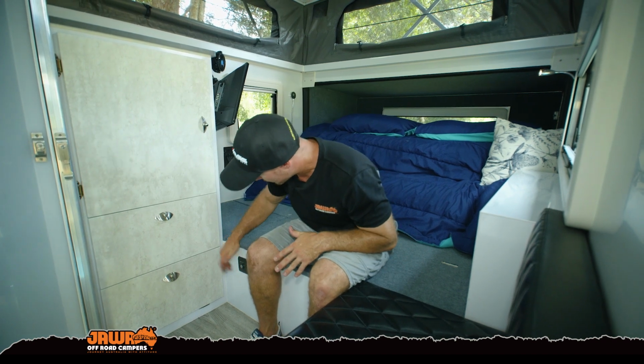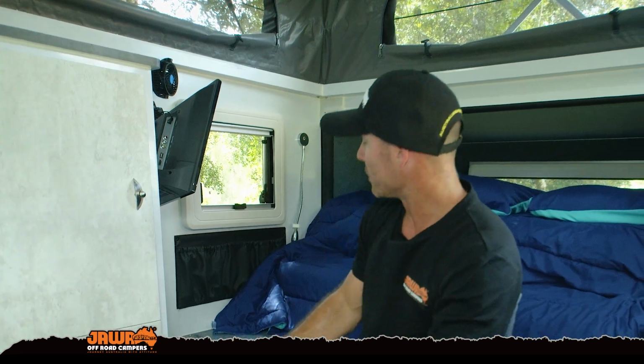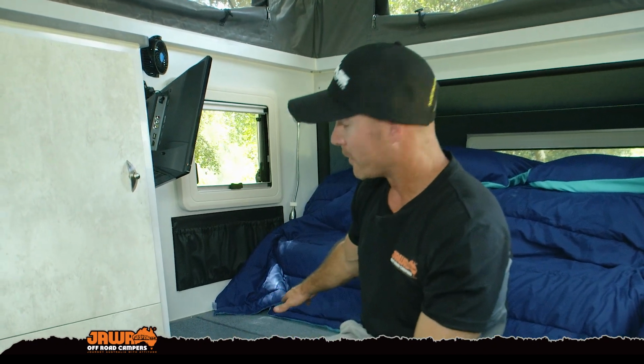Once the hot water system has ignited, you could leave that on the whole time you're at site, so that each time the system does cool down, it'll fire itself back up and heat to temperature. When you're done with the system, there's a little yellow toggle underneath to drain the system. Now, when you've put it into storage, Truma recommend draining that as it has no anode. So simply lifting the lever underneath from a horizontal position into a vertical, which will dump all 14 liters out. When you're finished, making sure you put back into the horizontal position.